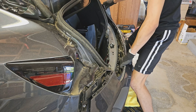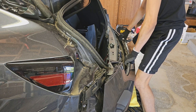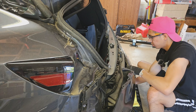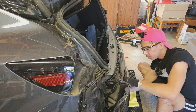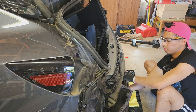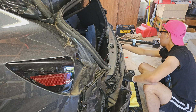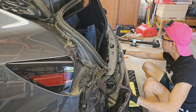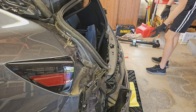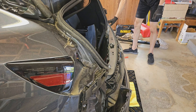There's a slight problem — why isn't the bumper coming all the way off? Well, yours should, unless you're like me and you have underglow. Pro tip: you could cut any zip ties holding slack of the underglow wire together and release more wire, allowing you to pull the bumper farther from the car. I didn't want to do this, so I made it hard for myself. The bumper should pull away from the car — I just had wires from my underglow on that bottom skid plate. It'll be so much easier if you don't have underglow, or if you just snip the zip ties and re-zip-tie them.